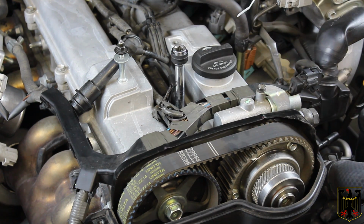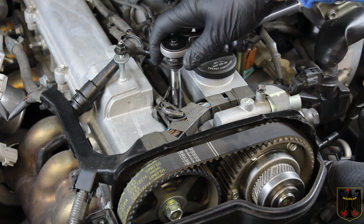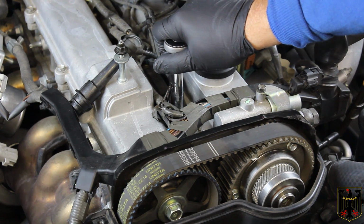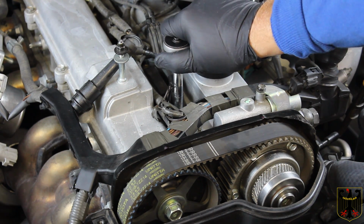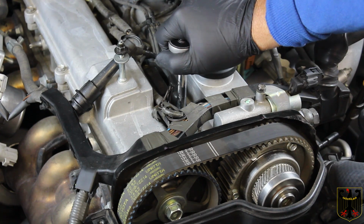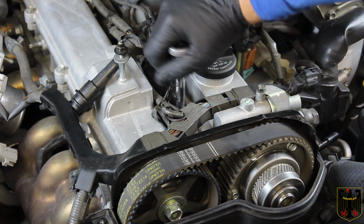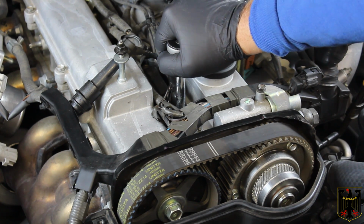And like I mentioned, you can't torque it properly with lubricant on it, so I'm just going to tighten it up by hand. And it gets somewhere around 10 to 12 foot-pounds of torque, not much. You can just sort of feel when it starts to snug up, and you want to just go a little past snug. You want to feel that little compression washer compress. And like I said, you're not going to use much torque. And then you can feel when it starts to stop. You can tell I'm not putting much torque on it.